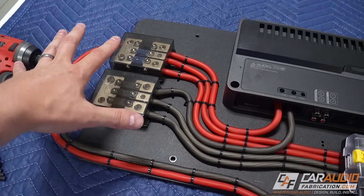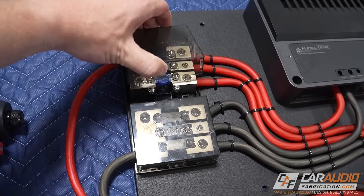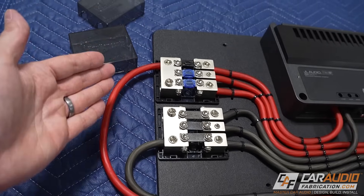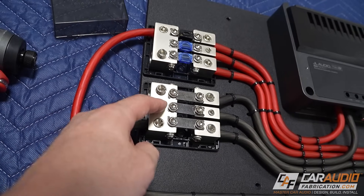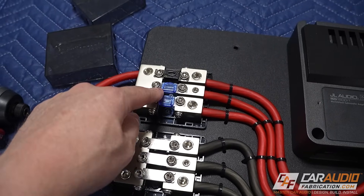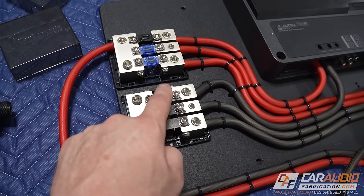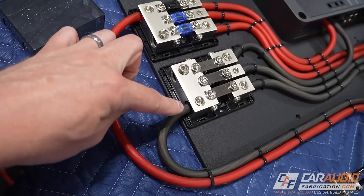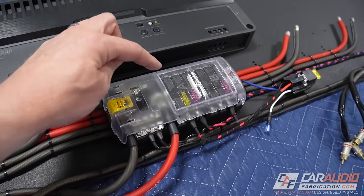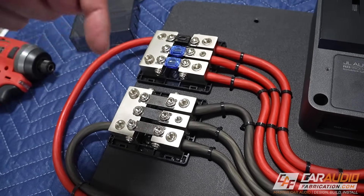With our subwoofer amplifier mounted back in position, let's go through a quick breakdown of everything that's going on here. I've got a positive and a negative distribution block — the positive is the one with the fuses and will have a connection coming in from the main power lead connected straight to the battery. The ground distribution block connects to the vehicle ground. These distribution blocks are from our show sponsor New Concepts. What I really like about these is that you can use the same distribution blocks for both positive and ground — you just use grounding links on the ground ones. They also have two inputs which allows you to daisy chain more distribution blocks. In my case I sent off some more power and ground to a separate smaller fuse block — the two inputs are zero gauge and it has three four-gauge outputs.